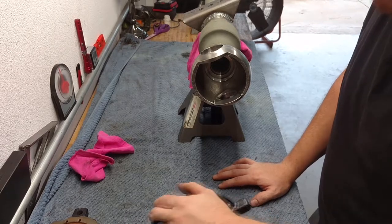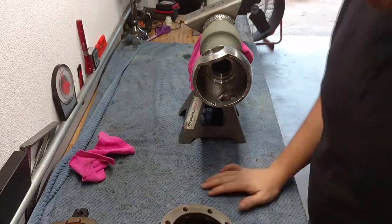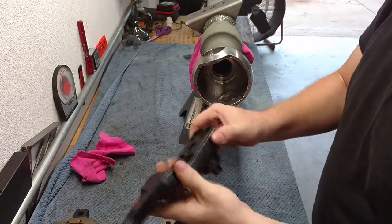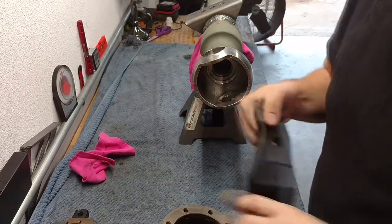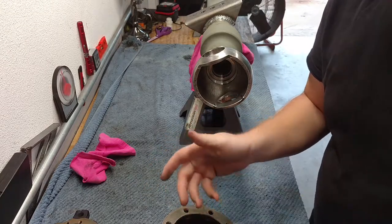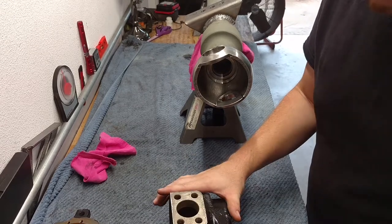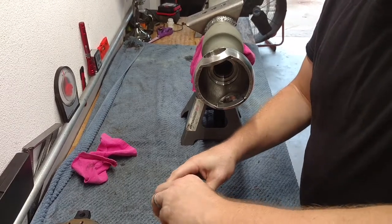I'll need those for making sure steering linkage and steering box clearances are there. I've got the knuckles here — I cleaned them up months and months ago and gave them a coat of paint. I have my upper knuckle cap slash steering arms. They've already been cleaned, self-etching primered, and I used a semi-gloss black. Got my lower caps cleaned up, ready to go. They've already been checked for any burrs, no high spots. I've taken a flat file and cleaned up the edges of the mating surface so caps will go right on with no interferences.